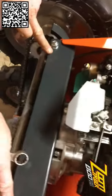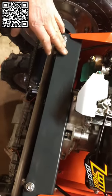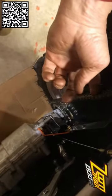Down here on the right and left hand side, you have your nuts that are going to tighten the chain. It's a simple operation — you put the wrench on, you turn them clockwise until you get the desired tension, about one inch. That's perfect.